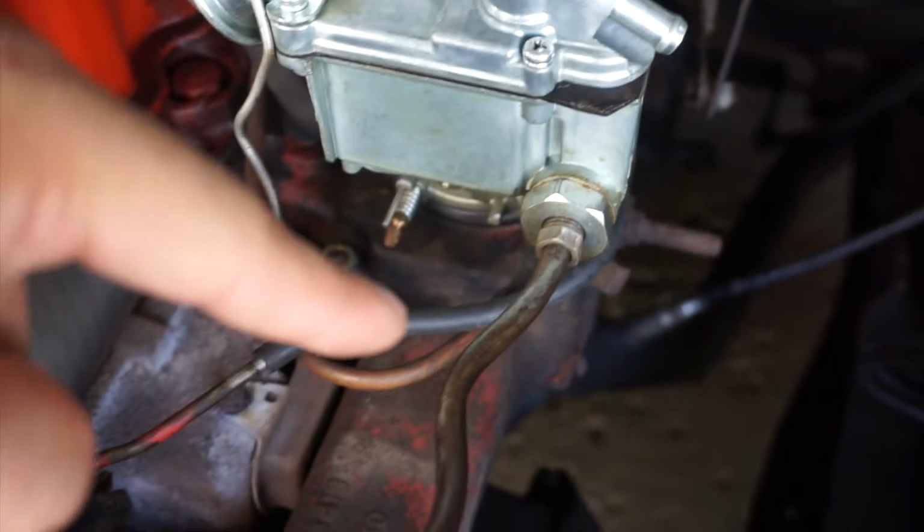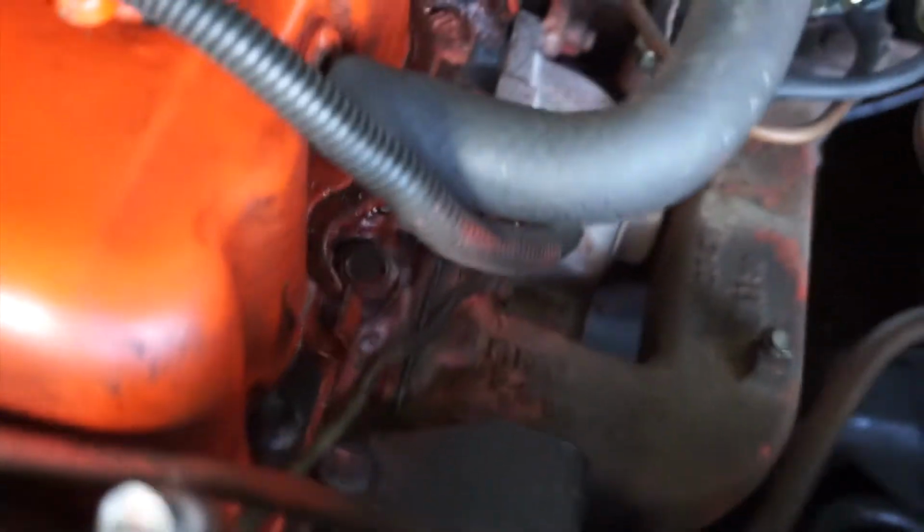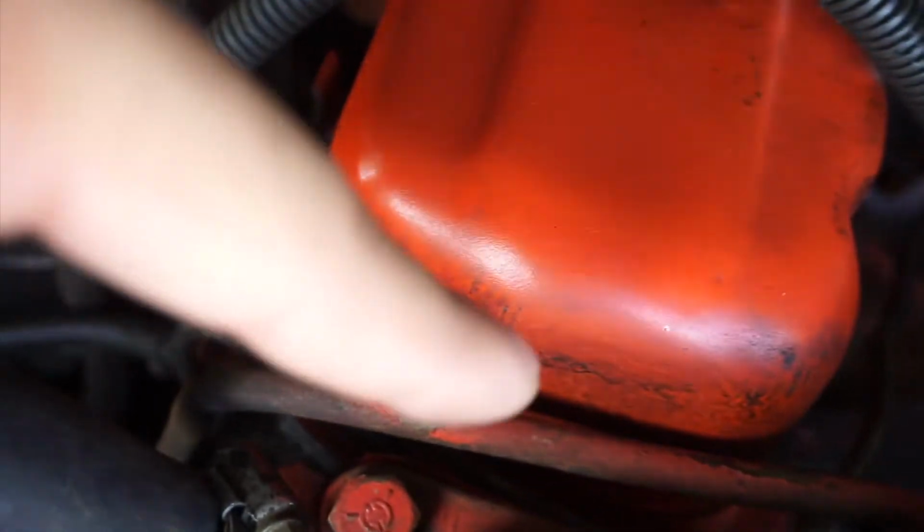There's a couple different things that can be happening with it. Here's what I think. If you look at the fuel line, the way that it runs is from the back, runs right along the engine block because it's a mechanical fuel pump, and then runs right on the front of it all the way up. So there's a lot of space where it's right next to the engine block. Essentially the fuel is getting too hot, and it's vaporizing, vapor lock, which is obviously potentially causing that issue.